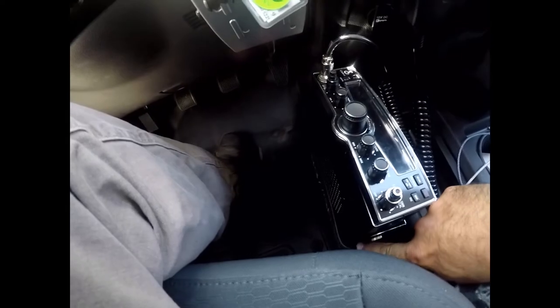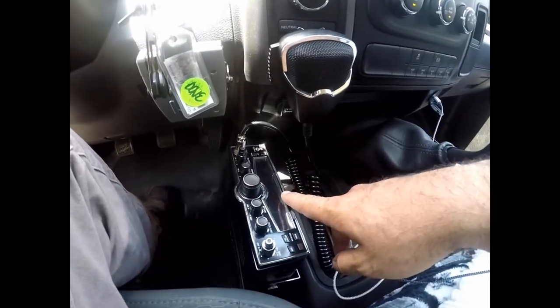That's pretty much it — stock mounts, a little ram carpet mount, powered directly to the battery. I had to splice in extra wire; I used 14-gauge, though 16-gauge would probably be better, and I think the stock wire might actually be 18-gauge. Other people use one or two steps bigger, so 16-gauge is probably the sweet spot. It's a pretty simple setup — just one way to do a CB radio install in this generation truck. Hope you liked the video, until next time.